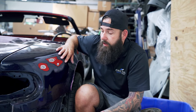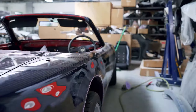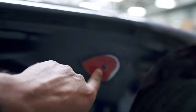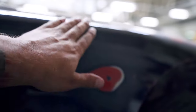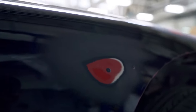This is a part of the whole build process — just to learn as much as possible, make mistakes, and then fix them. Let me show you what we're looking for here. Over here — this is exactly it. We didn't go through to the metal, but you can see the low spot. We're going to use just a small amount of glaze there, let it dry for about 20 minutes, and come back and sand it out. He was teaching me the sanding pattern too — go in X's and go with the body line. He said this is one of the most difficult parts of body work: getting it flat. We're going to look at it at different angles.